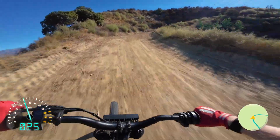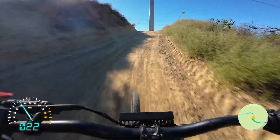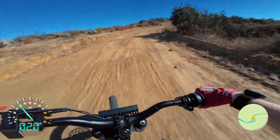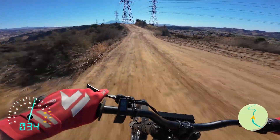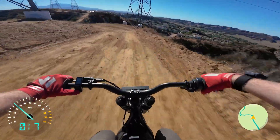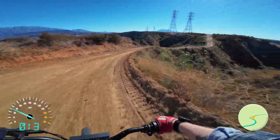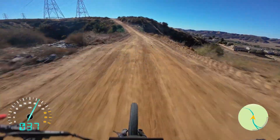I have no idea how fast that was. I should probably say something now. As you guys can see, I'm having a hard time keeping the front wheel down — that's how brutal this acceleration is. And also the other limitations on the bike now, like the tires, are starting to become more apparent. One thing I would definitely upgrade — I have to upgrade now I have all this power — is going to be the tires and rims. The problem with these skinny tires is that once you break traction, it's gone. A fatter, thicker rear tire is going to accommodate this power perfectly.